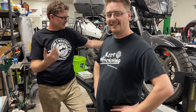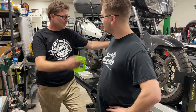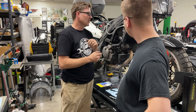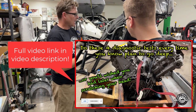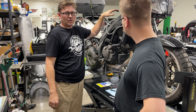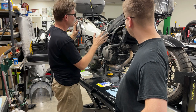We've been having some good meals and doing a lot of wrenching. Last night we made some more content on the generator, so we're really having some fun. He wanted to get a deep dive, and this is one of my own vehicles that I'm pretty sure had a bad motor. So I'm showing him how I go about diagnosing it from beginning to end. A lot of people yank out a motor and start looking at the nuts and bolts, but we don't start there. We started with testing electrical, and the point we're at right now is the cooling system — we tested that to make sure its integrity was good.